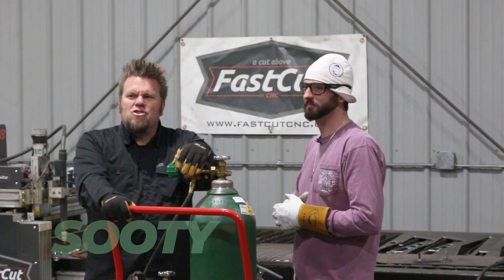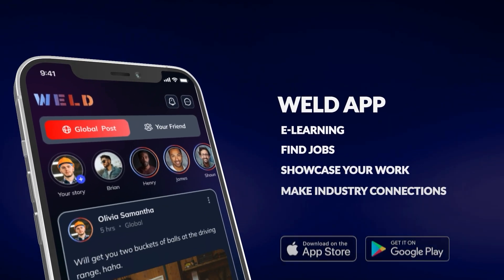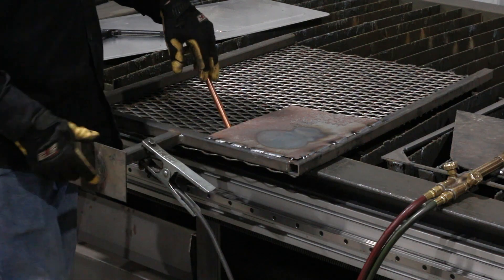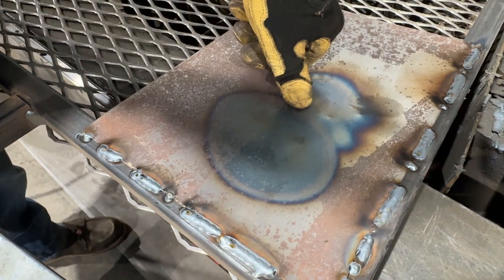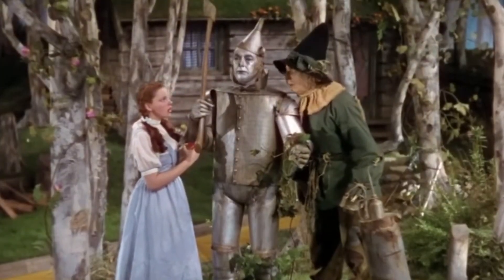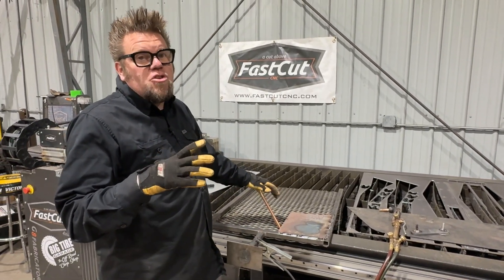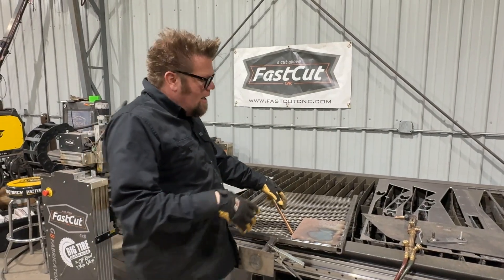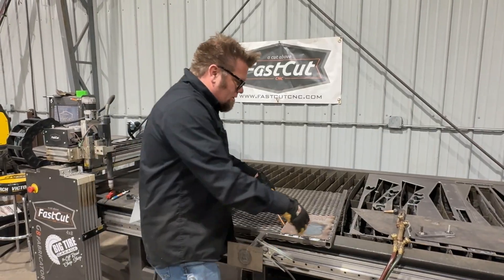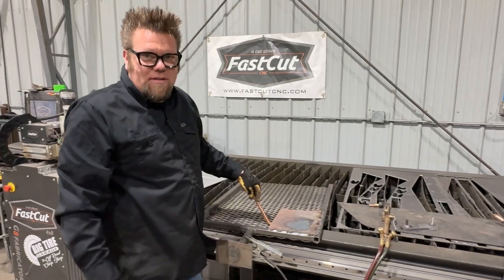Alright, so we kind of welded this piece of sheet metal just into this corner square here to simulate what's called oil canning. Quite often when you weld a patch panel into a vehicle, you end up putting too much heat into it when you're welding it in, and then what happens is it actually crowns out — it'll actually sit proud of the panel, and you don't want that. So you get that oil can sound, which is what you don't want.